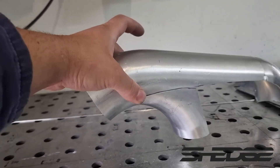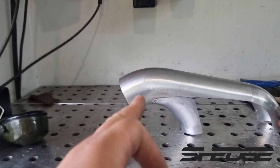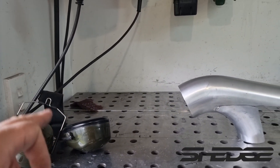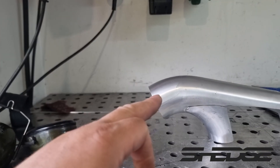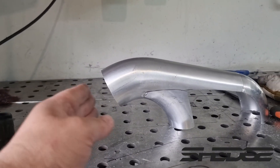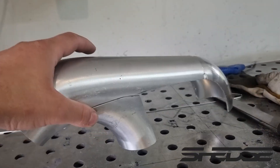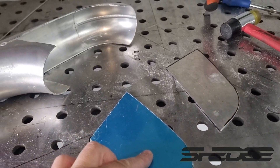One of the main considerations is this angle out here - we don't want heaps of different bends to make up the shape going to the turbo. We have the charge pipe coming out of the turbo which is going to be level, so if we make this a 45-degree angle we only need one bend straight up into the throttle body. We also need to make an adapter for the throttle body and an adapter from the throttle body to a wiggins-style intercooler clamp.